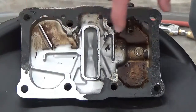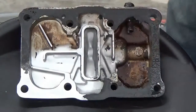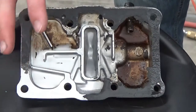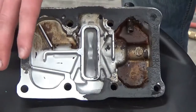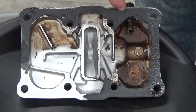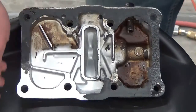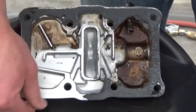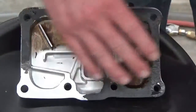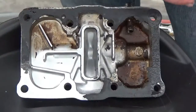This applies to automotive stuff as well — you can get into these areas and clean every piece and part on these engines, or any engine for that matter. But again, you cannot remove gasket that has not been scraped. If you've scraped the majority of it and broken that very hard surface, you can get it off and peel that gasket off. So this is just a good example of whether vapor honing can remove gasket, and if so, how.